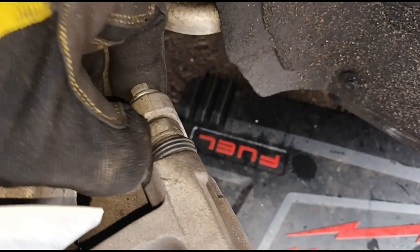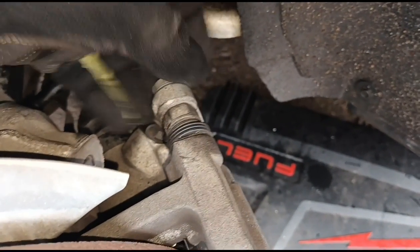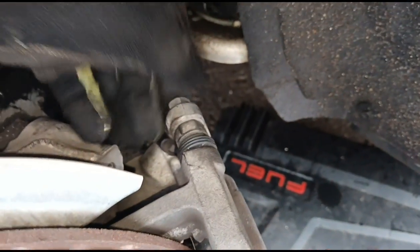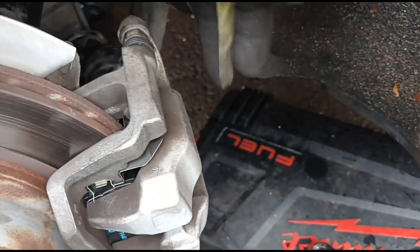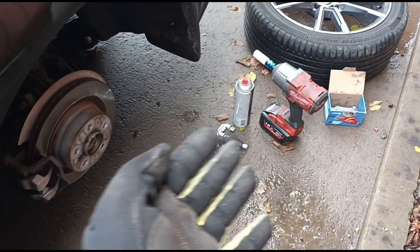Because this is an almost new car, you can see the slider is moving nice and freely — we don't need to pull them out and grease them. If it's an old car you'd pull those sliders out and re-grease them before you refit them. Now it's just a case of putting the sensor onto the back brake pad, right there on that little notch. Get the new sensor back onto that and plug it back into the box up there.